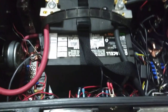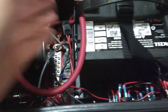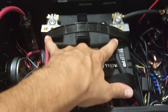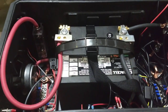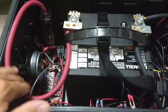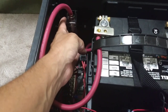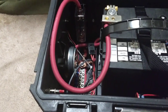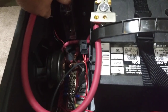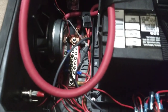Now let's talk about the bus bars. We have a battery mounted in a tray in the bottom, so if there are any spills or corrosion, everything stays inside the tray and doesn't get into the toolbox itself. Terminals are up top — we want to keep these away from anything that could potentially cause a short circuit. The positive side goes directly into an inline fuse, so anything coming out of this battery has circuit protection. That goes through the automotive fuse down to a bus bar, giving us 12-volt DC all the time as long as the fuse isn't popped.